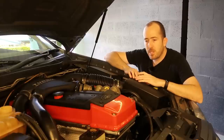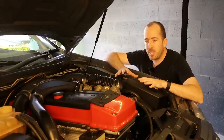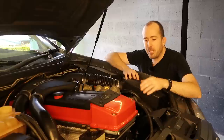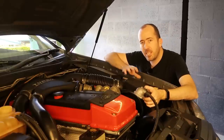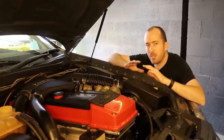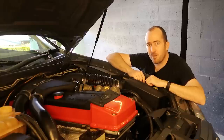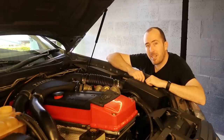What I'm going to do next is put the bottom radiator hose back on, start to fill this thing up with the new coolant up until it gets to the thermostat housing, and then reinstall the new thermostat. Put everything back together and then fill the coolant up the rest of the way — and of course after I put the new reservoir on as well, which should look fantastic.